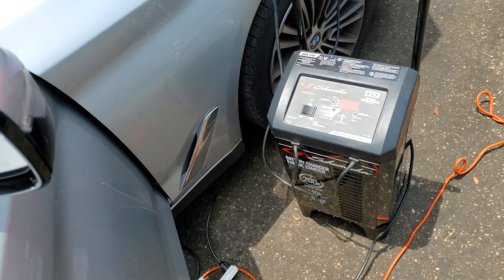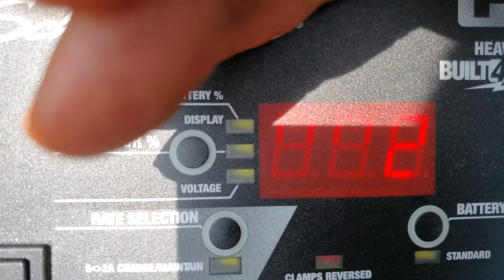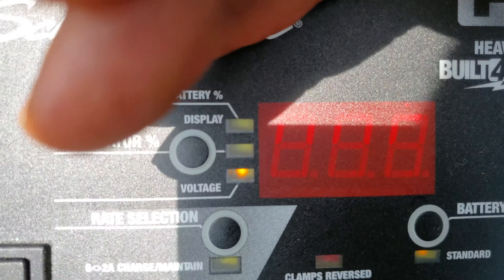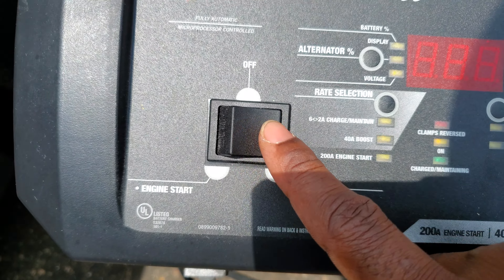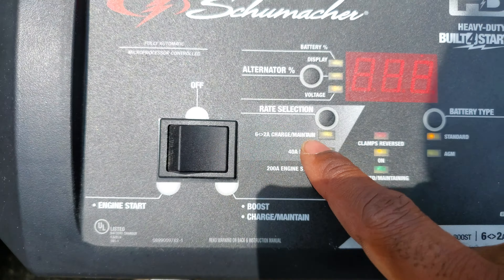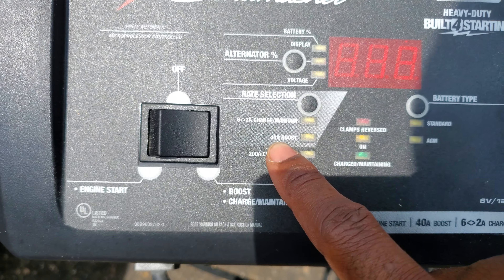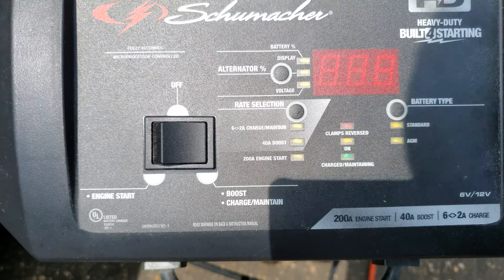This car is a 2017. To turn on terminal 15, where the light comes in the cluster, you can put the key right there at the cluster where it can be near the antenna, or you can put it right here in the cup holder. And you depress the start/stop button three times in a tenth of a second to turn on terminal 15. That is how they created the new terminal concept on modern cars nowadays.